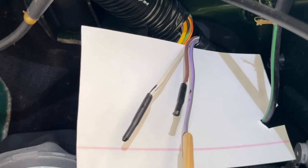Come over here and open your glove box, and remove whatever you have inside. To remove the glove box, come to the side and locate the pin — put your finger underneath and pop it up, and it'll pop right out. Then right up here you'll see a little tab — there's one on either side. Push them in, and your glove box will fall down. Inside the glove box, the orange wire is your antenna wire. Next to it you'll see the brown and white wire we connected under the hood, and the white wire that also comes from under the hood.